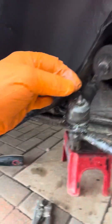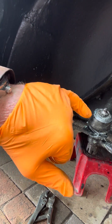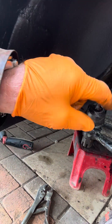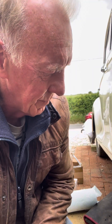So if you do damage - I did damage also by using this thing. I did take this off but I seem to have damaged the actual thread on the inside. So putting the bleed nipple back was a real problem. What I did was use an M6 tap and die thing.